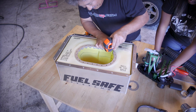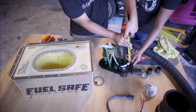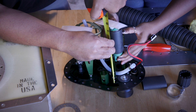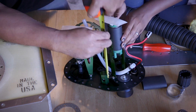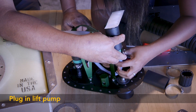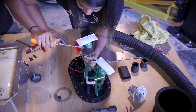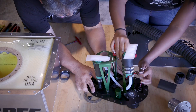So you want to measure how deep your fuel cell is. From the top of the flange to the bottom it's about 8 and a quarter inches, so from the flange to the bottom of the sock has to be 8 inches. Now we're going to connect this filler hose and plug in the connector. Then we put the two hose clamps that hold that in place, finish tightening down the clamps, and put down the bracket that holds down the fuel filler tube.